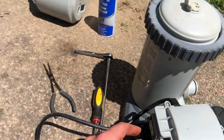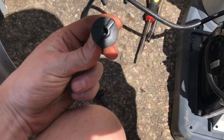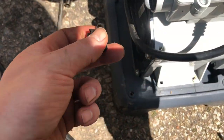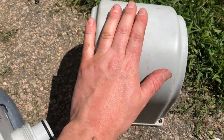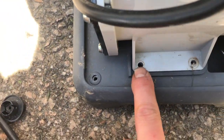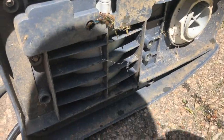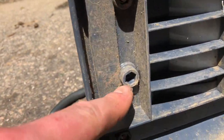Now the next thing you wanna do is put this cover on, and when that cover goes on, you're gonna get this in there, okay? That little screw and the knob for this timer here. The orientation for this doesn't really matter. You'll see it has grooves and it'll slip on, so don't even worry about that. Prior to installing this cover though, ensure that you have these 4 mounting screws here installed. If it feels like one of these screws isn't going in, there's a good chance that the nut came out from the bottom. So press that back in and then start screwing it.